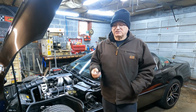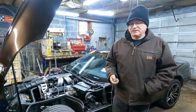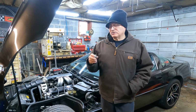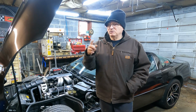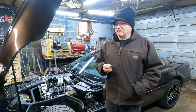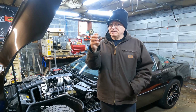All the knocking is as soon as you start it up and are just backing out of the driveway. There's no load on it, so there shouldn't be any pinging or knocking going on, and there's no discernible pinging either. All the false knocks, what I think are false knocks, are happening in low load, low RPM conditions. Under high loads and high RPMs, I'm not seeing any knock at all. So I'm thinking it's false knock. It could be the new knock sensor I put in is oversensitive.